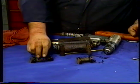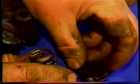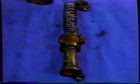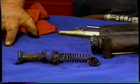We'll change that spring out. There's a valve in the end that I was talking about, and we've pounded that a bit, but we can find another one of those. And this used to be a cup washer. And that was a seal, that's the valve, and that's how that master cylinder comes apart. In a normal situation, this would have just floated out once we took the clip out. But there, all the pieces are there, and when we put the sleeved master cylinder kit together, you'll see how it all turns out. That's the master cylinder stripped.